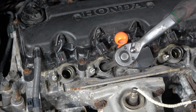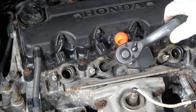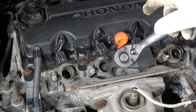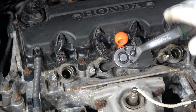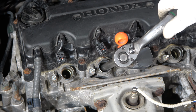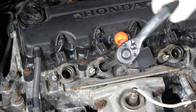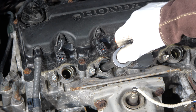And when we use this wrench, this is quite okay. We can change these spark plugs using this wrench, but we have to be careful because this is a small wrench, and if we tighten and rotate this spark plug too much, it can get damaged and go totally broken. And it is then a really bad situation, and that's why we should use a torque wrench tool, because this force is 20 newton meters or something like 15 foot-pounds. It is possible to get this force when I use one hand only in this way, and now there's about 20. But let's check.